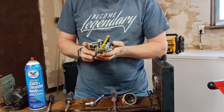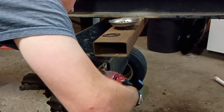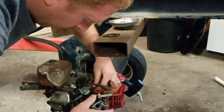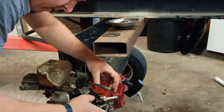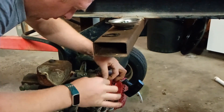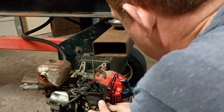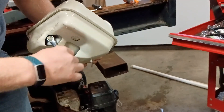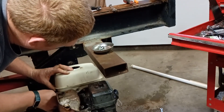Let's get this mounted back on the motor and we'll see what happens. Start by snaking the fuel line back up where it belongs, get that partially on, then replace the linkage back on here, get its spring back on, line up the air part levers, and get the nuts and bolt on. Last thing is to get the tank back on. Word to the wise: put the two studs in the back first, then rock the tank in a little ways, then put your fuel line on.